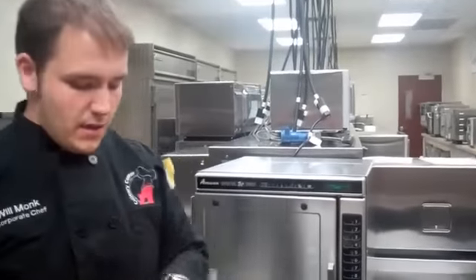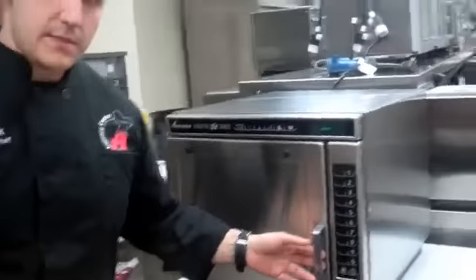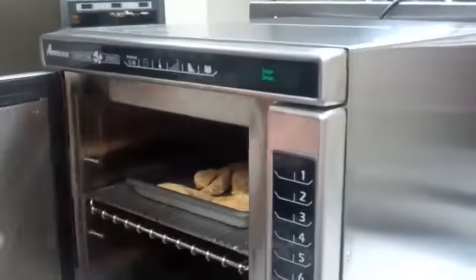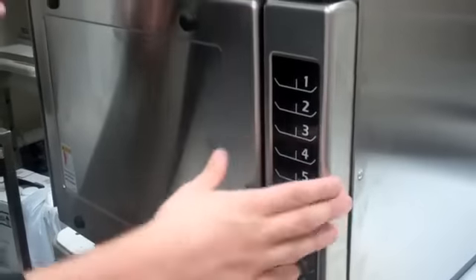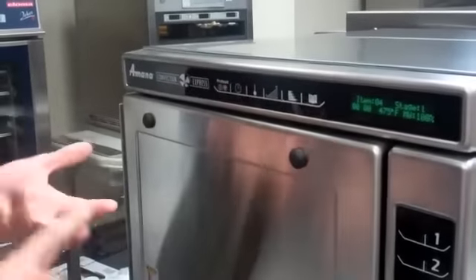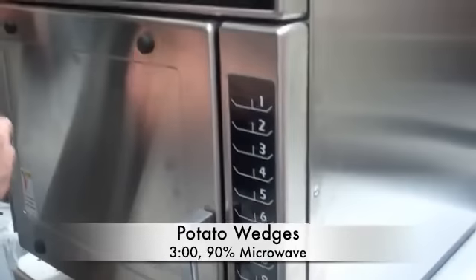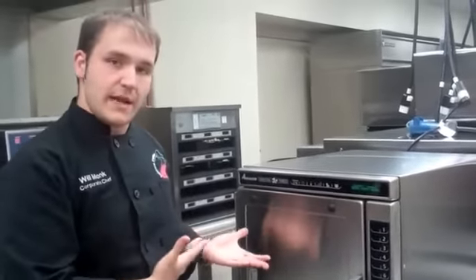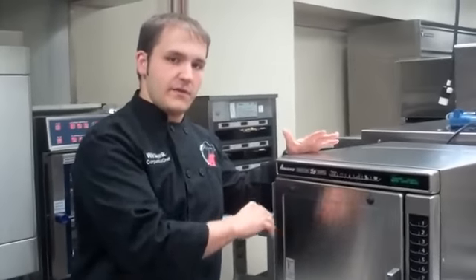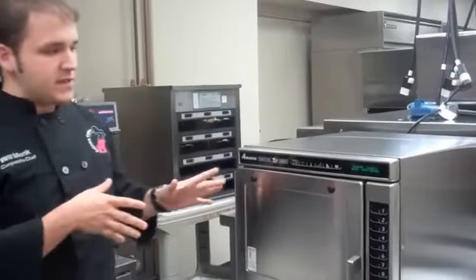The last item is potato wedges, which will show the browning capability of the oven. I'll do a manual cook on this so you can see how programming works. Put the product in the oven, shut the door, hit the book button — which is programming — touch whichever slot you want to program (number four is empty), then touch the clock to enter time — we'll say three minutes. Then touch the power level and set 90% microwave for those three minutes. Touch the book again and that program is saved. Press number four and our three minutes at 90% is off cooking. This oven also lets you transfer all 100 programmed items from one oven to another using a card — just download the information onto it, take it to another oven, and upload it so both ovens will be exactly the same.